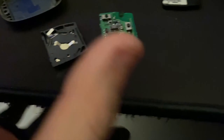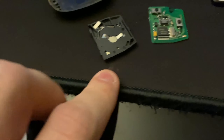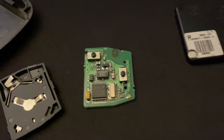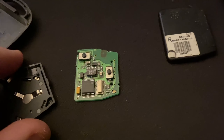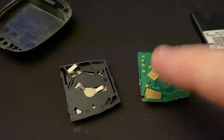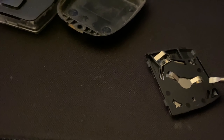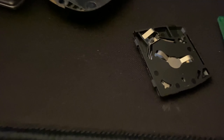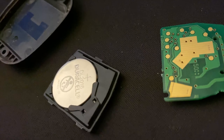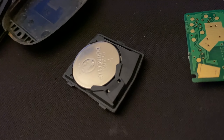Mine wasn't working after I even changed the battery, so what I did is I took it out of its case. The buttons are usually kind of bad for going — you can get replacement buttons for them — but my issue was that the back of this wasn't making as good of a connection as it should have been to the battery. So I took it all off, pried up everything so that it's definitely touching. Same with the other contacts on the bottom of the battery — they've all been pried up as well.